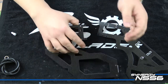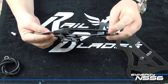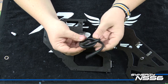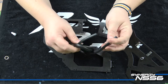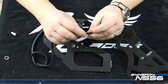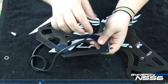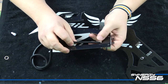The next step is to take this rubber carbon edging and put it around where the tank goes on the frame — it just keeps the carbon from wearing a hole in the tank. This is pretty straightforward but can be a little tedious as the rubber is thick. Some guys soak these in warm water to loosen them up. Make sure before you trim it that you shove it into the corners as much as possible so it's fully stretched, otherwise you could end up with a gap where the tank goes.